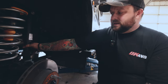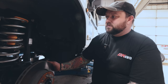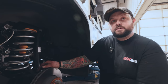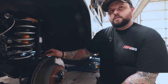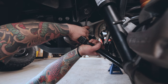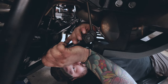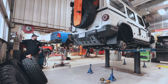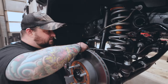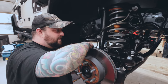We got it down on the jack stands so we can get the shocks lined back up to get the bolts in. That will be the limiting factor so it doesn't droop out too far when it's back in the air to get all the rest of the components reattached. Once the shocks are in place, I'll hold the axle high enough that the brake lines won't be under stress, and we can put those back in place. Now we're just getting everything back together — putting the brakes back on, getting some of this stuff tightened up.